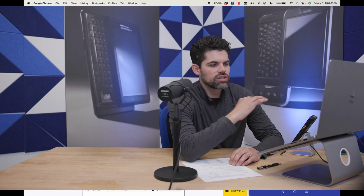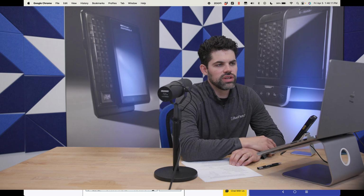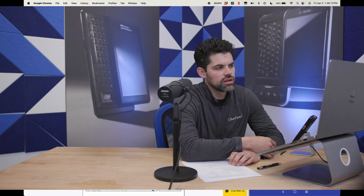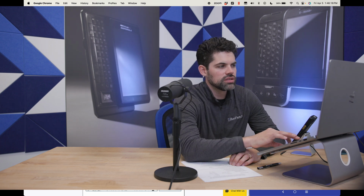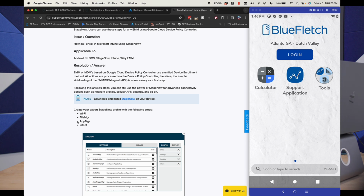The device, as we mentioned, is currently enrolled in Workspace One, so we'll be able to deliver these steps to the device and then trigger a reset. And upon reset, the device will then go apply the steps in this serial order. This is what Zebra calls persistent storage. So these tasks and these processes are set as persistent in the device, which means they will be retained regardless of the reset of the device, as long as it is an enterprise reset and not a factory reset.